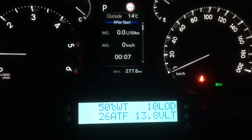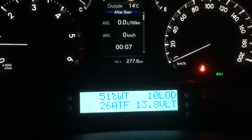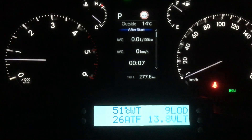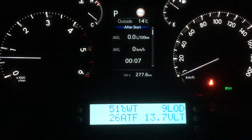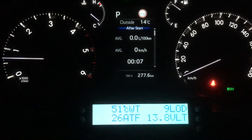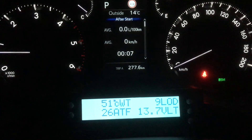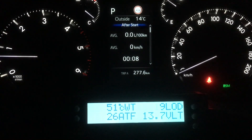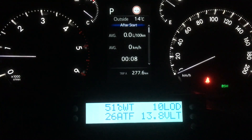The reason we've gone back to these is we really want to monitor the transmission temperatures. Before long, you'll see a scan gauge in each of our vehicles. We're also going to come up with PID codes to monitor EGTs and DPF percentages. There are a few readings I'm not really interested in, like torque converter temperatures. If the transmission only has a torque converter temperature, that's the one you watch — but note that when it's slipping, it'll go up quickly, and as soon as you back off, it'll come down quickly. What we're really interested in is that pan temperature — that pool of oil — not just a small amount of oil in one area getting really hot.